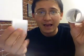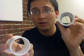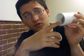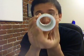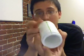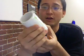Now you're going to take your end cap, recall the two different notched sides, so we're going to take the larger notch, and that's going to be at the bottom by the part of the blade that's closer to the end, and the smaller notch will be on the top. And so we're just going to do it this way for you. I'm going to line up those two notches there. And the big notch is going to hit first, of course, and start sliding in, make sure that all aligned. So a second notch and the whole thing nice and firm again. And voila, there you have it. Brand new blade in here.